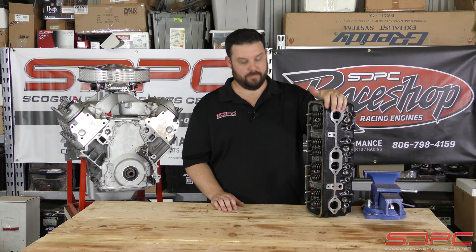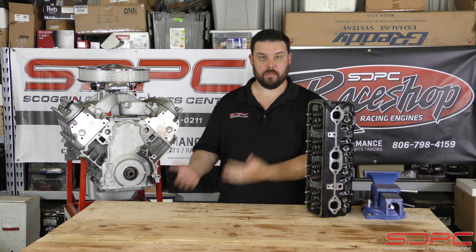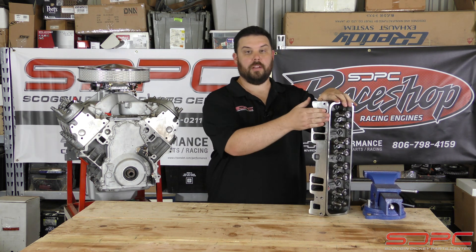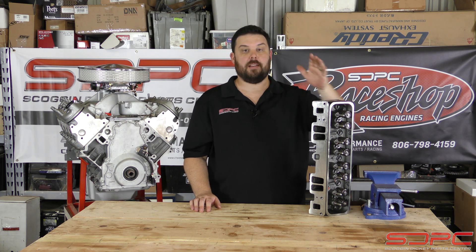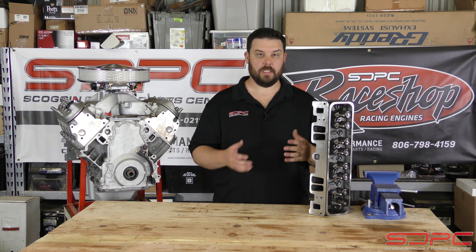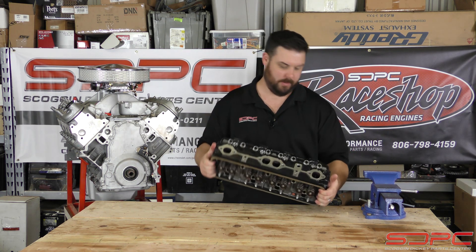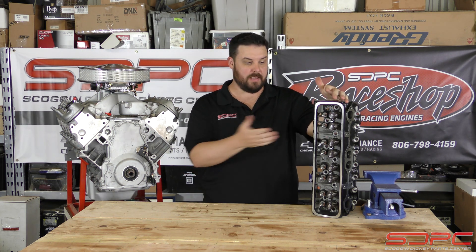But here's another reason. At this price point, there's a lot of really high quality cylinder heads these days from companies like Edelbrock, Trickflow, Dart, and Brodix. They make aluminum cylinder heads both in the standard intake pattern and the Vortec intake pattern. Remember, the Vortec heads had that special vertical bolt pattern — two on each corner, so eight total. They make them in that and the standard pattern for guys that just have a normal small block. They're high quality, they have the same lift that these things can handle, they flow really well, and they're aluminum. We walked this over to the table to make this video and almost threw my back out — this thing weighs a ton — and the aluminum heads can be had sometimes for $1,000 to $1,300 or less. That beats these out of the water.